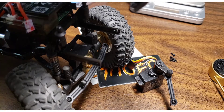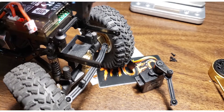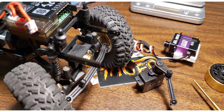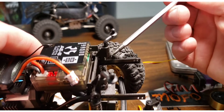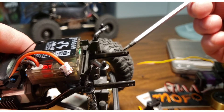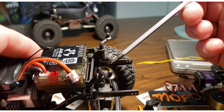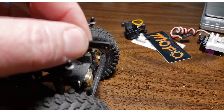I've pulled the bumper off — just a couple of little hooks that hold it in — and I've taken the servo out too. I'm going to see if I can rig up the MoFo RC servo into the stock mount and make it work. If I can't, I'll throw in the Reef 99 sized one. One more thing while this is torn apart: I'm going to cut these frame rails — probably about here and here — and just get rid of the front part. It's forward weight but it gets in the way. I'll cut them back far enough so it's still clear of the cords for the light kit.